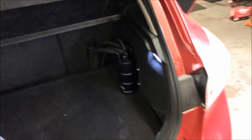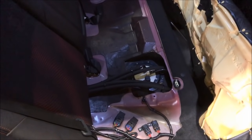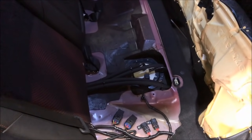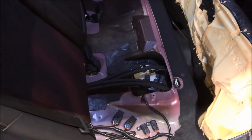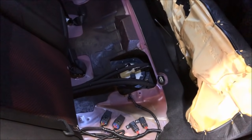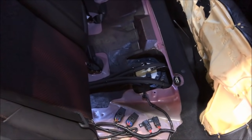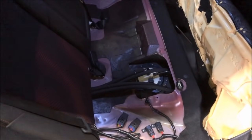So that's really cool. On my Speed3, I have a Walbro 450 that just sits in the stock tank. I have a Squash Performance top hat that I don't believe is made anymore. I don't think you can get them anymore. So I kind of have to be careful. Usually below a quarter tank, I don't like to do pulls, because I fear basically starving the engine of fuel. It's worse in a drag racing situation, because the fuel really sloshes around a lot.